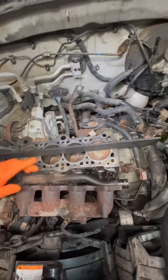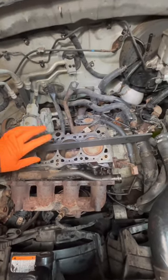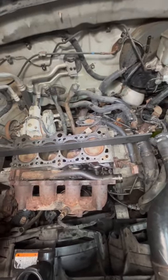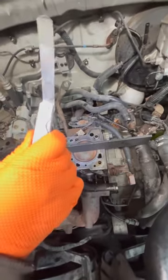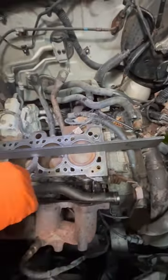The proper way to check your cylinder block or your cylinder head for straightness is with a precision mechanic's straight edge — you can't use just any kind of straight edge. What you do is put it down, take a two thousandths of an inch feeler gauge, and try to put it under.